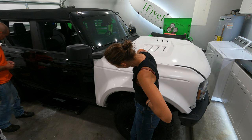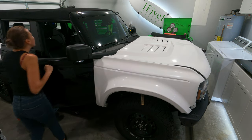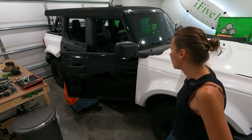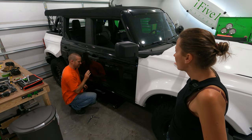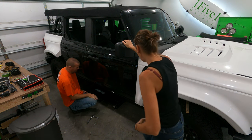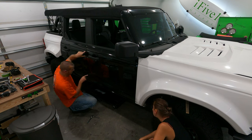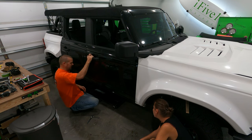This sticks out. What he's doing now that you really can't see — he's adjusting the hinges on the rear. Because we still have a little bit of a gap issue from where these two doors meet. He's popping this one out, popping the bottom one of this one out. This right here is perfect — that whole front piece is perfect. This right here, I have a gap right here. So what I'm doing is there are two hinges, one here and one about here. There's two bolts on this one, one bolt on this one. So all I'm doing is undoing this bolt and pulling the door out on the bottom and then I'll re-tighten it. Now it's a lot better, but I still want it out a little bit more.